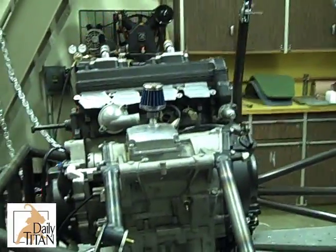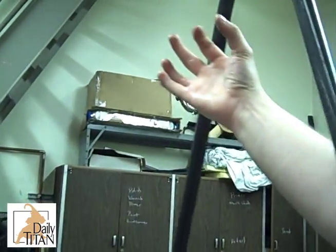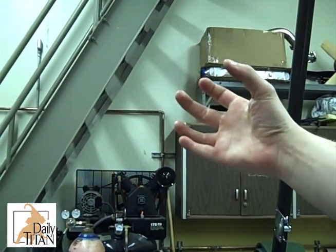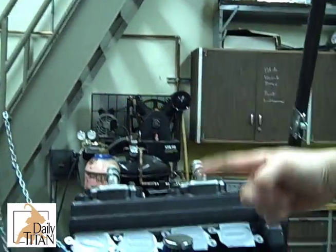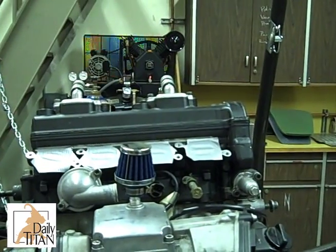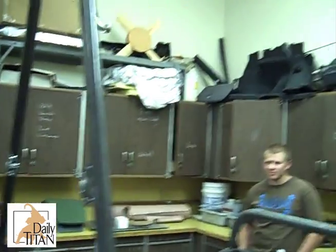So you're running a Yamaha R6 engine. What's been done to it — it's not just a stock motor, right? We have a 20mm restrictor that goes in the intake. We're going to have a throttle body up here and it comes down to a gradual step down to the restriction and a gradual step back up. Then it comes into the plenum and we have four separate runners out of the plenum, tuned for about 8 to 10,000 RPM. All the air has to go through a 20mm diameter circle — about that big — which will cut us back to about 70 horsepower.